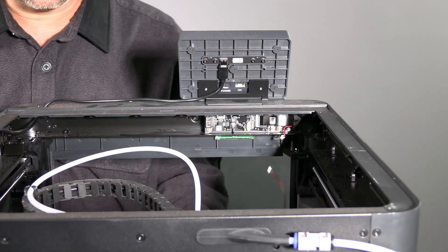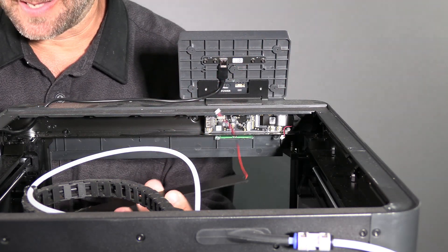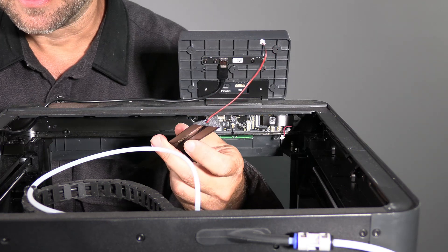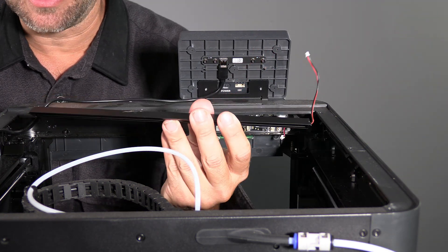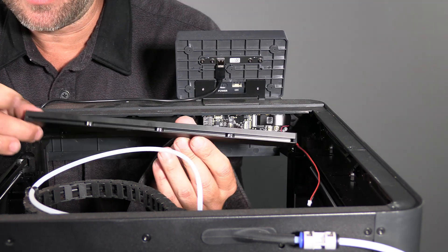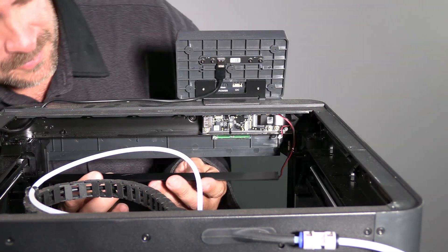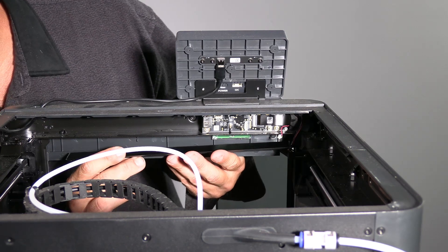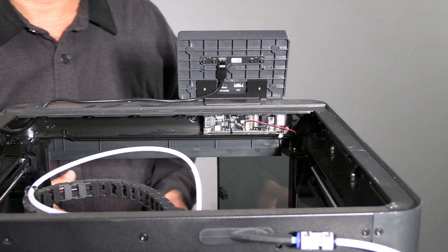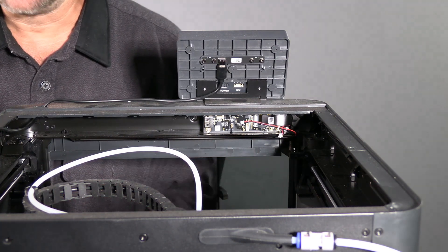You are going to bring the LED light from the top or through the door inside the printer. You will see the cable is on this side. The LED light faces down, and the little wedgie part — the point faces the back of the printer. You can use double-sided tape for this; however, have a look at the back of this fixture and you will notice magnets. Come down, find the little lip underneath that circuit board and place the light strip right there. The magnets have snapped to the metal casing and your LED light is installed.